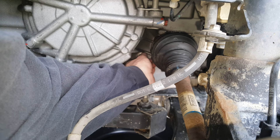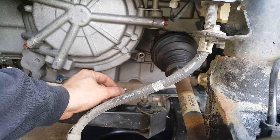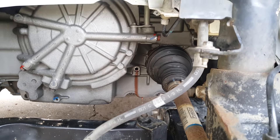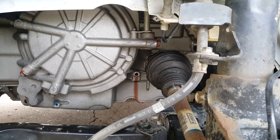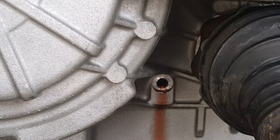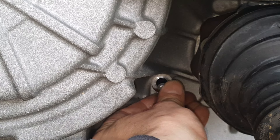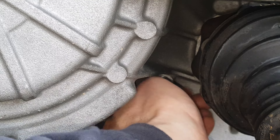I'm going to try to get up here and get it before it falls, and we'll see what we've got. We can see it's trickling out there a little bit. I went up top and poured just a little bit in — now you can see it's trickling a lot faster. Basically, you want it where it's just trickling out of that hole. If it's pouring out, you've got too much. Once it's trickling out, you know you've got the right amount. You can verify by just pouring a tiny bit in and it shouldn't take much — you should see it start to trickle out.